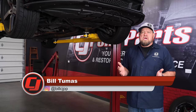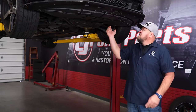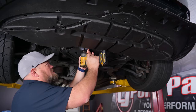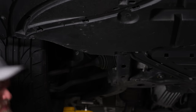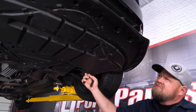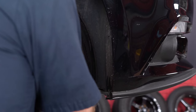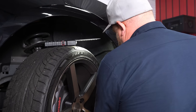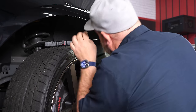The Oracle headlights are easy to hook up, but you do have to remove the bumper to remove your factory headlights. So the first thing we're going to do is get underneath the car, disconnect the screws and push pins for the belly pan, then go into the wheel wells and then up top. Move down to the wheel wells and remove the clips down there as well. The third clip is harder to see because it's pretty high up. Once you get that one off, pull the fender back.